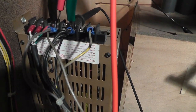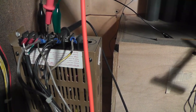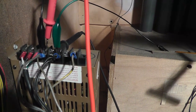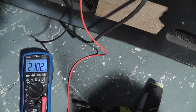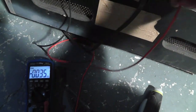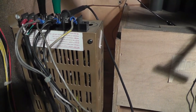Listen to what you hear — it's almost like something's cooking. It might be a capacitor. It's running with a 5-ohm load, which is about a 1-amp load. Checking voltages: 12 volts is about 11.93, negative is about 4.7 — might need to go a little higher on the 5 volts when we plug in the PCB. It does seem to be working relatively well, just that noise is interesting. I don't know how long it'll last — I might just stick a new power supply in.